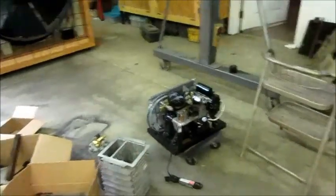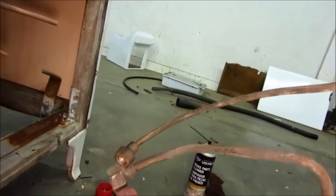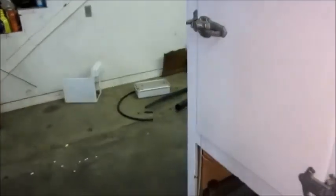Tomorrow I'm going to set the compressor in there and take some measurements, because these lines are off of the unit that I got the compressor from — from Travis — and mine are cut off. So I'm going to have to get everything cut to the right length and solder it back together. All right, that's it for today. Thanks for watching.